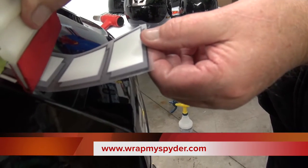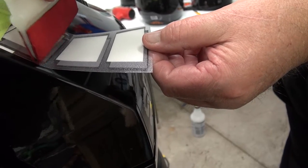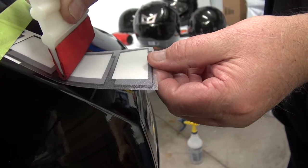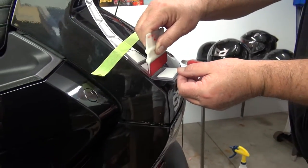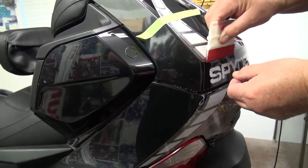Push, push, push, push, push. Change the angle on your squeegee back a little bit and push it back towards the bike. There you go. Slowly work the film into position. If you want to do longer strokes you can, but overlapping strokes are a very, very good technique, because that ensures we won't have any air bubbles — all the way down to the bottom.